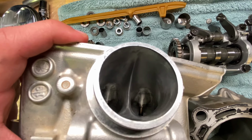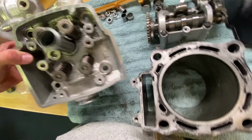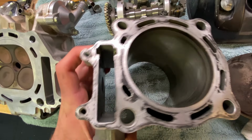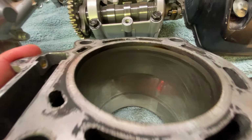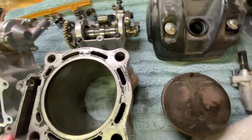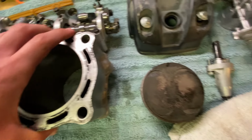see the port that was done about 10 years ago and was rebuilt the first time. I don't think the exhaust was ported or anything, but this was the stock cylinder since we had the bike brand new. The bore still has all the cross hatching, still looks absolutely brand new. The bike has at least over 500 hours. It's pretty amazing how well it's worn.